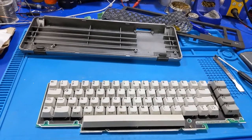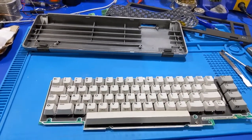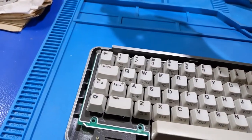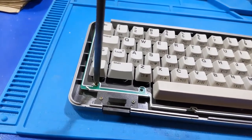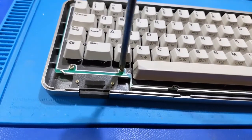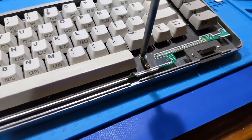Let's get it put back together, and let's hope, by some miracle, that this keyboard works. And I didn't lose any additional keys, because they all worked except for the other bottom row and the spacebar, which was circuit number 2, one up from the bottom here. Now, I'm not going to snap this plastic on until I know for sure that it works, because the last thing I want to do is break things that don't need to be broken unnecessarily. I'm not going to snap it together and then have a problem with it, and then unsnap it and snap it together again along the way.